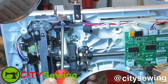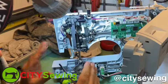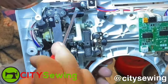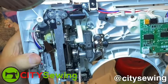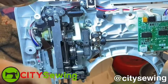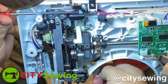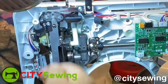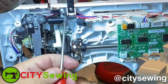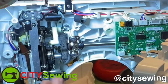It will tell you: you have to bring the foot down. So this part is going to go back, and the sensor is telling the machine, okay, I'm back into sewing mode. This silver plate that you see here moving goes all the way from top to bottom. When you push it up, it pushes to the side. But this part here gets stuck on the bottom — it's not set up with a screw, it's just a little clamp. So when you do this, this part is not moving; it stays on the left. You lift the foot up and the part is not moving — it stays on the left. It doesn't matter how much you go up and down. This part needs to move up and down and left to right — that activates and deactivates it.